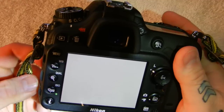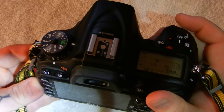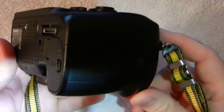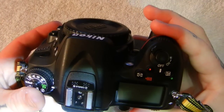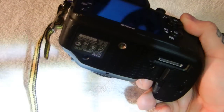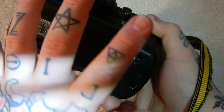Check scratches on the bayonet mount. Check your flash. Check the bottom to see if it's been treated badly. Check your corners for dents — that's typically from some careless owner having their camera flopping around and banging in doorways. Check your shutter count: take your laptop with you, don't trust anyone about what the shutter count is. Usually they don't know or they're going to lie to you. Check your hot shoe for corrosion. Smell the camera — smell for smoke or a wet moldy smell, like someone's had it stashed in the basement.